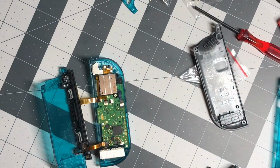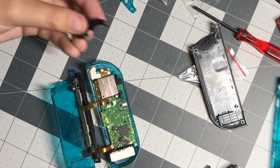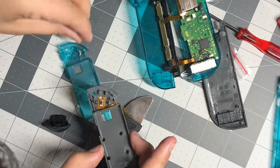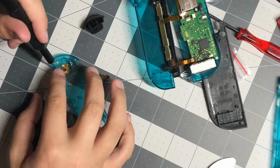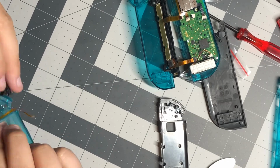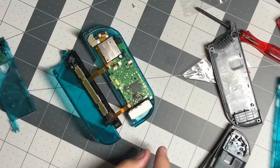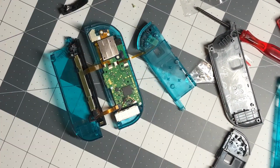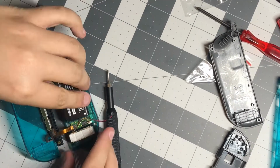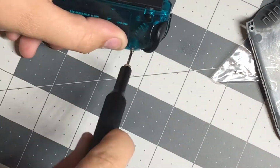Once the motherboard was intact, I began to move the second piece over, and it was just one screw, and I lifted it and dropped it into the back shell casing. For the trigger buttons, you just pop them off and push them back on to the new casing. Once you attach the trigger ribbon back, you can put the battery back in and close up the case.